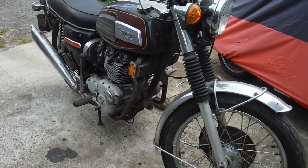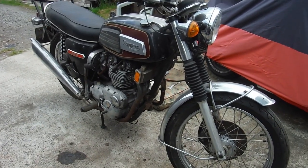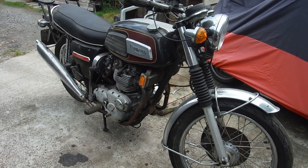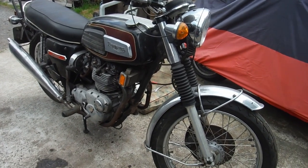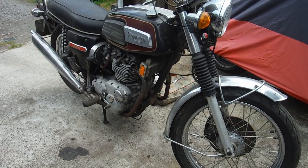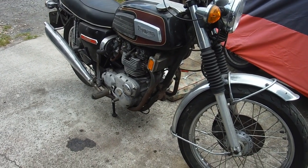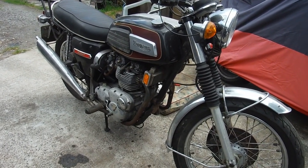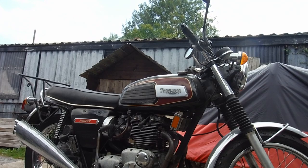I've drained the oil from the crankcase — it was wet sumped — and poured it back into the tank because it was very clean; I changed the oil last time I dusted it down. I've robbed the battery off one of my other bikes and reconnected the petrol pipes, which I'd disconnected. There are three sets of points on this one so we might not even get a cough — they might want cleaning. But I thought I'd put a battery on it, connect the fuel pipes, put some fuel in, get the engine oil back into the tank, give it a few kicks and see what happens.